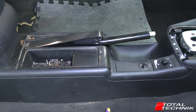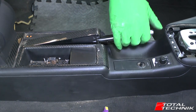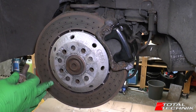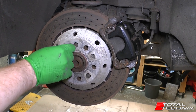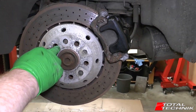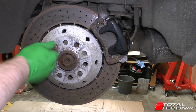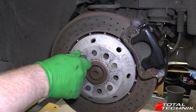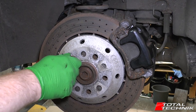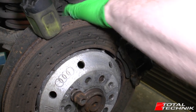Next stage: we've removed the bolts and we're ready to actually remove the caliper from the discs and pads. But we've got the tension on there from the handbrake, so pop in and release your handbrake — make sure it's completely off. Then, just before we start dismantling, for the sake of safety, take a wheel bolt and put it in as close to top centre as you can. If the brake disc becomes loose and decides to fall from the car, this will stop it landing on your foot — it's a simple safety precaution.